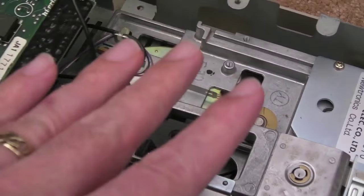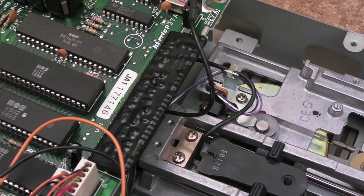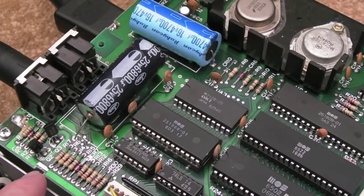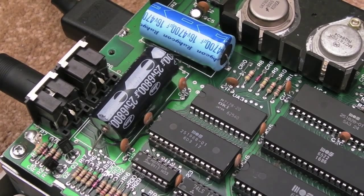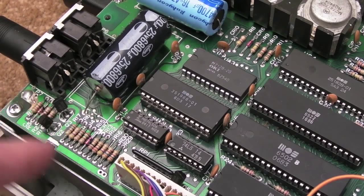Because the coils were fine, I didn't rush to spend more time cleaning the heads — I was convinced the heads weren't the problem. This morning I was actually convinced that the part that drives the heads was the issue. Looking at the schematics, there's a protection mechanism to stop the drive writing during power transitions — a 12-volt VF line, I think it's called. The schematics reference Q4 and Q5, but there are no Q4 or Q5 on this board revision, making it hard to locate without proper schematics.